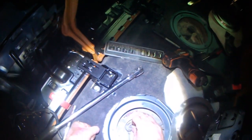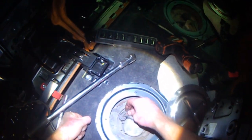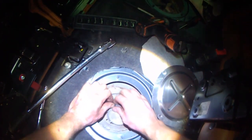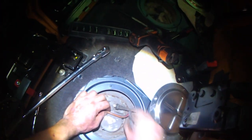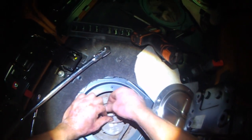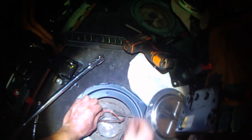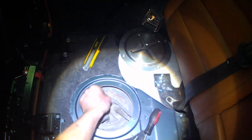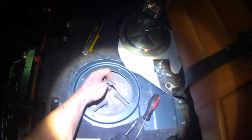The best thing to do is a current ramp test, which I might do on this one. Basically, open up the wiring harness, get your inductive clamp, and clamp it on the power supply wire. You do the same thing on this side.